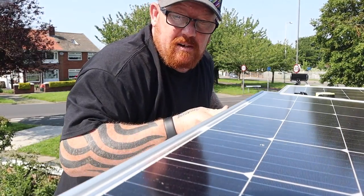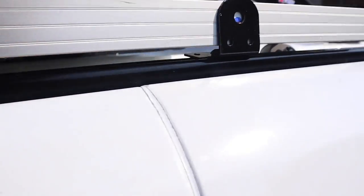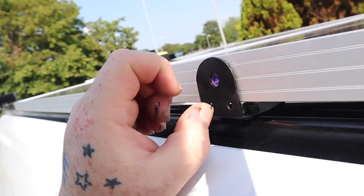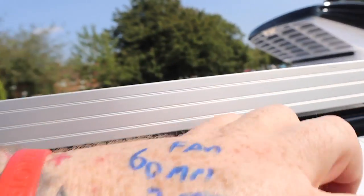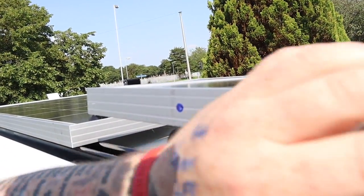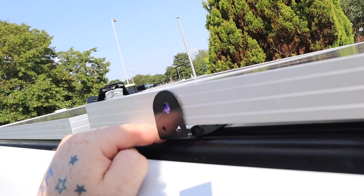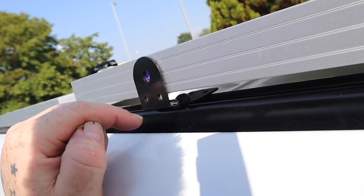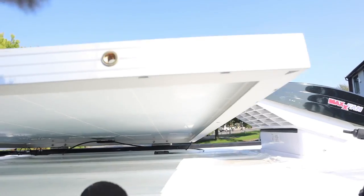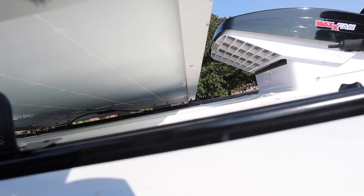Take our bolt, go through the uni-strut, fix the back into place, and then they're perfectly secure. Once we lower the solar down it fits perfect. So we've marked where we need the rivnuts on each side - that one needs to go up just a little bit - we can drill them, then put the rivnuts in, and from this side we've got a big knob that goes in. When we want to undo the solar, we undo that one and that one, and then the solar will lift up. It's just a little bit tight but that will give in time. That's going to be fine - maybe I could do with a plate on top to stop it squishing a bit, but for me that's good. Let's drill them out and get the rivnuts in.